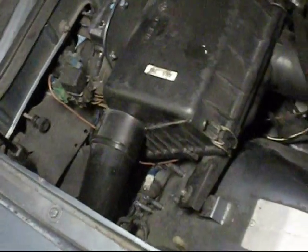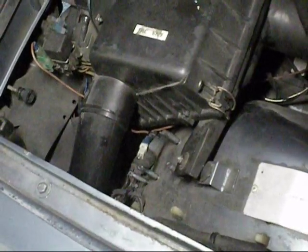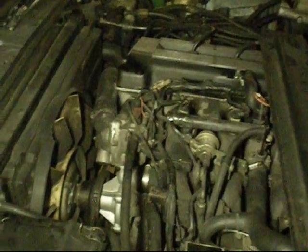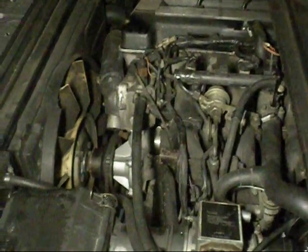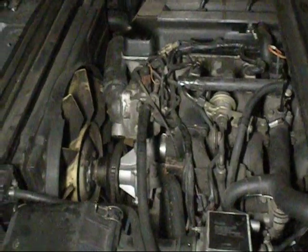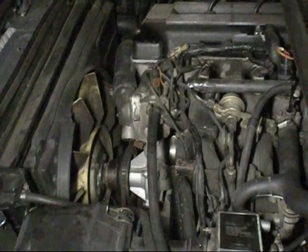Stupid thing. You're going to have to fix all this properly too — that's just crap. And that light doesn't even go out, so I don't know what's going on. Well, I got this running and played with it some more. I thought it was running quite hot for having a thermostat stuck open. It was getting up to about 80 degrees.